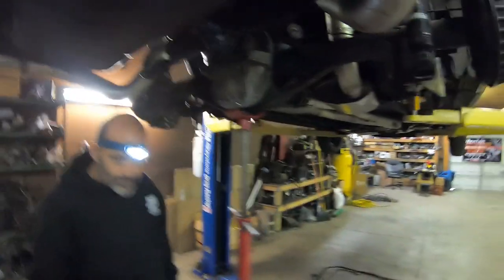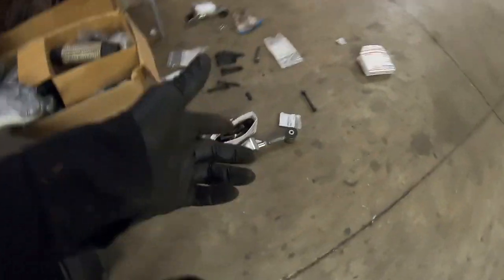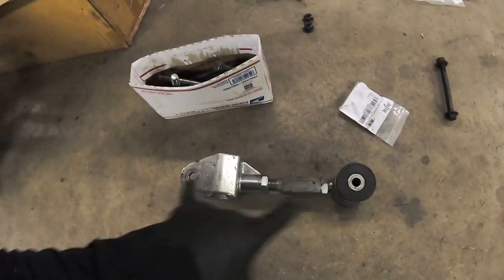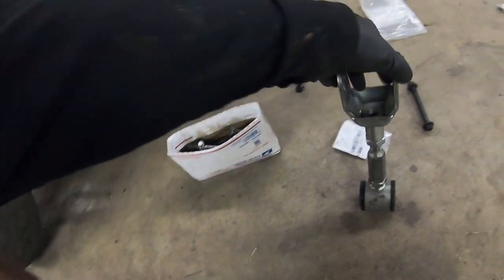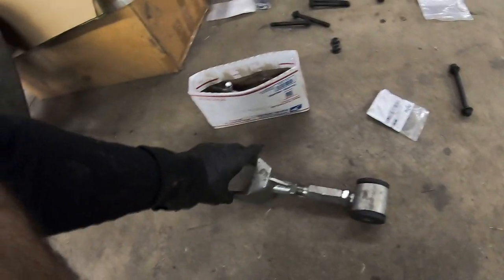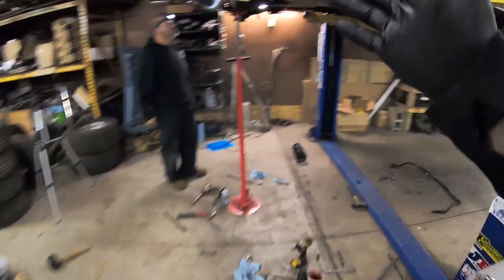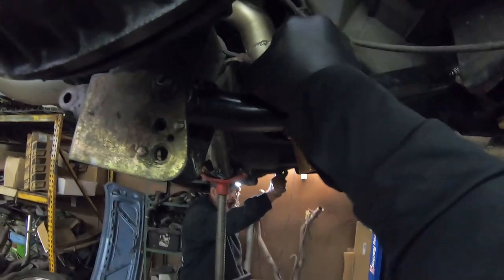So, we're gonna go ahead and get our upper control arms in, which are actually adjustable for our pinion angle. They still have bushings on them that I'll have to keep an eye on, but these are all new and ready. They were measured exact diameter as a regular one, just like the lowers were. So definitely gonna get them in there, and I'm gonna probably make a big difference for us, get some new bolts in there and some anti-seize, and maybe adjust my pinion angle sometime. One of the very cool things about the weight jackers, like I was telling you guys, is I can actually adjust my height. Excites me because I'll be able to maybe run a 28 with this car. Stay tuned.